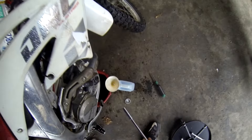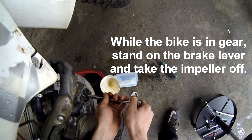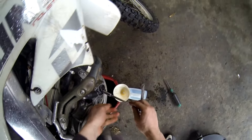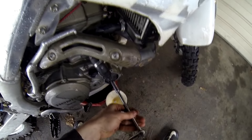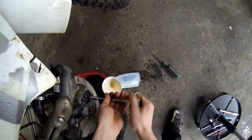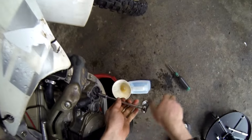At this point you have two options: you can either remove just your impeller, or remove your entire right engine cover. I'm going to choose to just remove the impeller because I suspect a bearing problem. This lets me check for excessive play in the bearing. Also, if you've put your water seal in backwards, this gives you access to fix that without taking off your entire right side engine case — as long as you're very careful and patient.